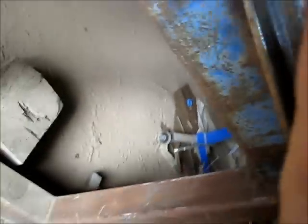Alright, that's exactly what I was trying to avoid. I'm pissed off at that — I really wanted a good tube. They've got pinch marks here which can cause tubes to puncture. I really wanted a perfectly good tube. This is how I get it off — it's the hardest part. You push it off the tyre and drag it under, then work your way round and push it off the rim. The rim's not as bad as I thought, which is good. I might have been using this tyre again — definitely not now. Too dangerous anyway.